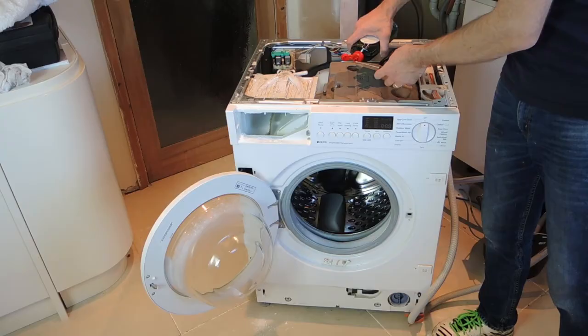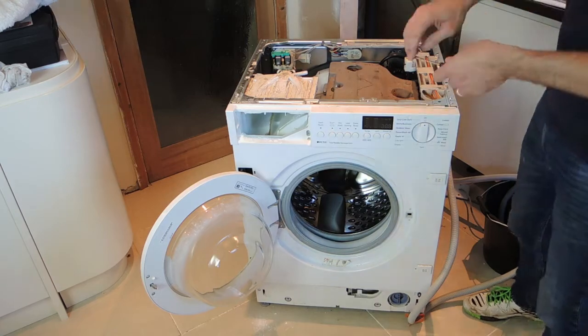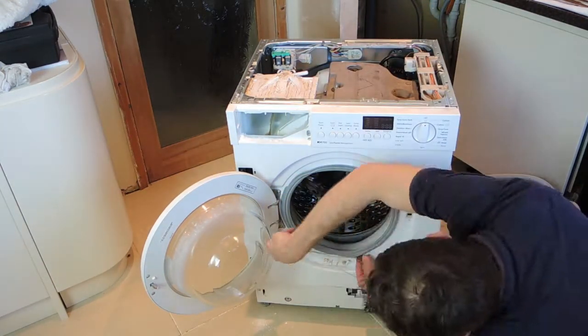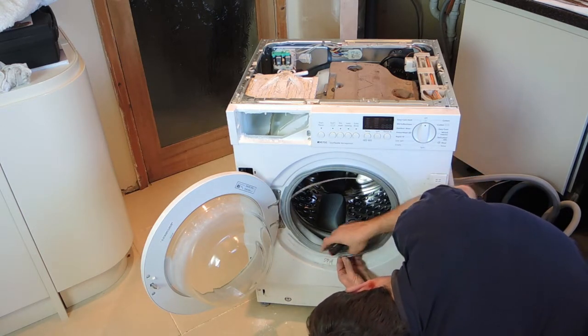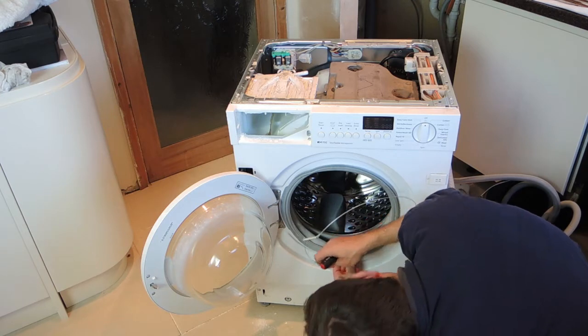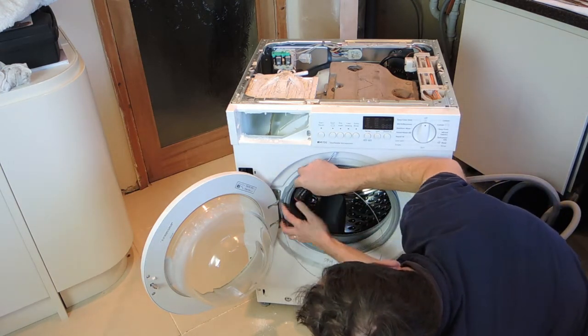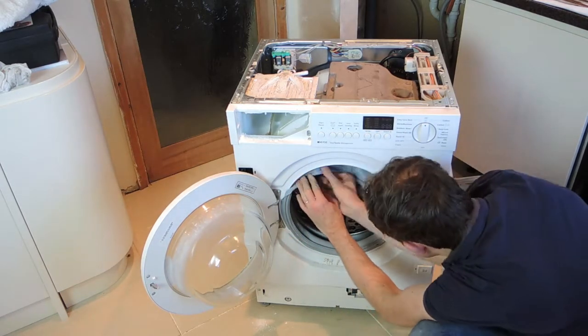Here comes the soap tray — just press down on the lever in the middle. I've put some washing up liquid onto the screwdriver just to help it slide in and remove the retaining ring around the rubber seal between the drum and the front of the washing machine. A bit of washing up liquid does help avoid any damage to that rubber seal. Then fold the rubber seal into the drum.